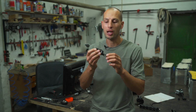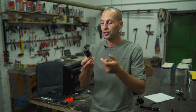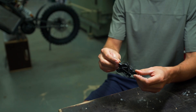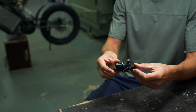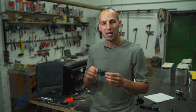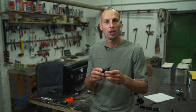This is a small Shimano caliper — a two-piston — and these calipers are totally fine for low-power and low-weight bikes. If you're a light rider you're completely fine and these will do a great job for you. But once you start playing with more power, more torque, and you're a heavy rider on a heavier e-bike, this might not be enough for you. You might consider four-piston brakes for sure.